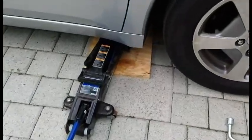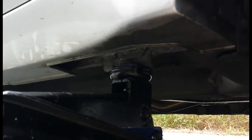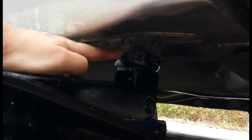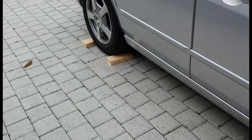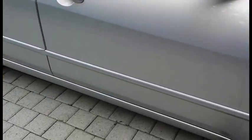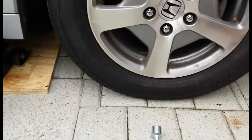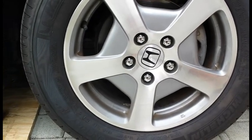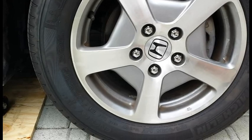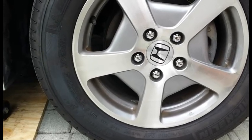I've secured the jack on this little piece of metal that is meant for jacking up the car. I've secured the back tire so the car doesn't roll forward or backwards, and I've lifted the car just a little bit to take some of the weight off the tire before I crack the lug nuts. Next I'm going to crack the lug nuts a little bit, maybe a quarter of a turn or half a turn, just to get them loose.